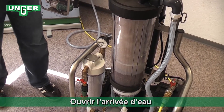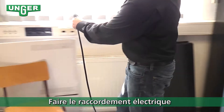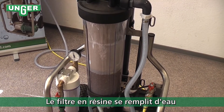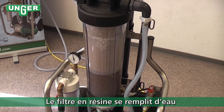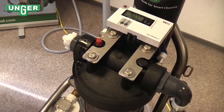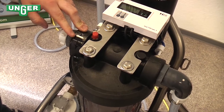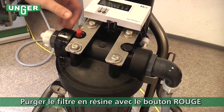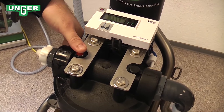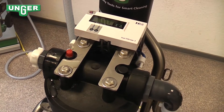Now you want to get started. You're going to turn on this valve and then connect to the electrical socket. The resin filter is going to fill completely up with water. Something important is right here — our air vent. In order for the TDS meter to work properly, you have to press down on this air vent and release all the air that's inside. Now it's good, and your TDS meter will function properly.